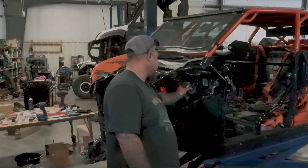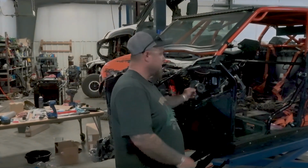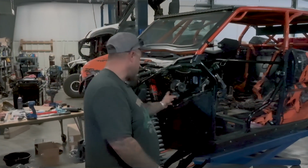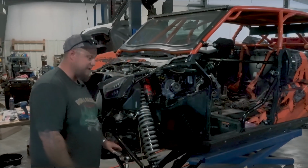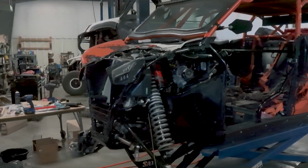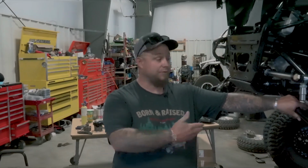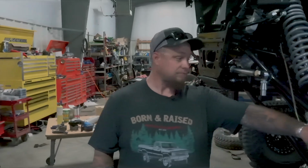And the orbital valve will sit here, and we will basically just run our hoses from there down the tunnel and towards the full hydro ram here. Let me raise this up. Okay, so first of all, this machine is running a 6-inch long travel, 3 inches on each side. And it's also running a 4-inch GDP portal.